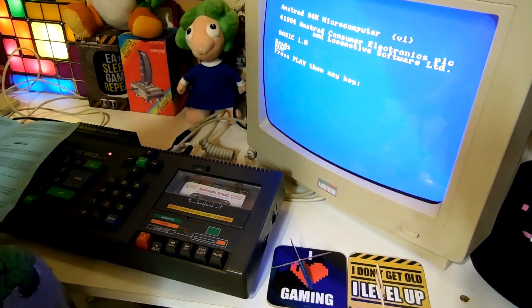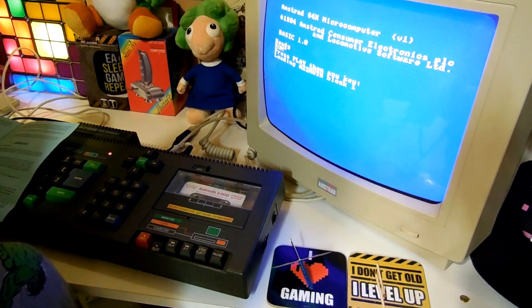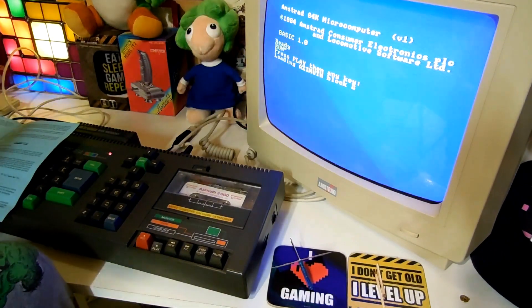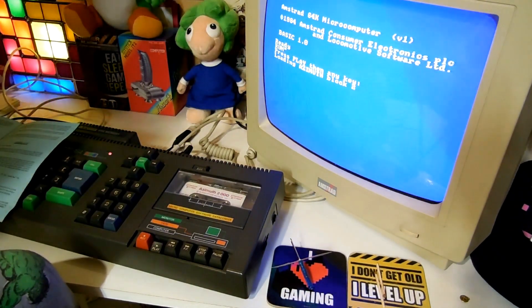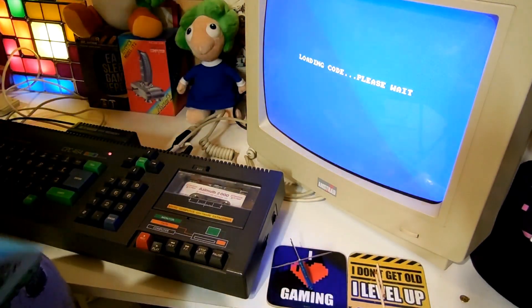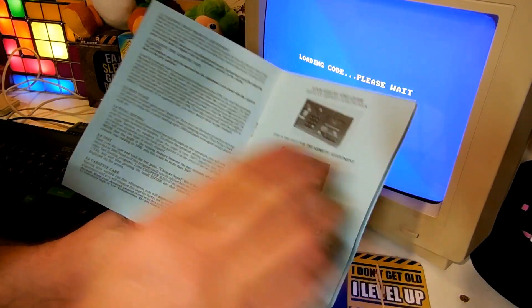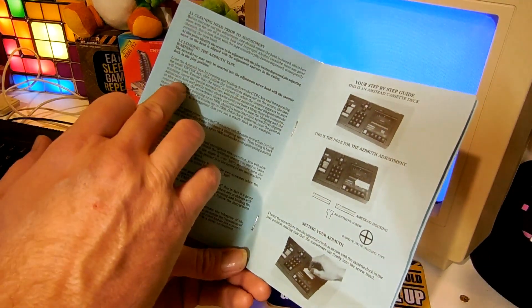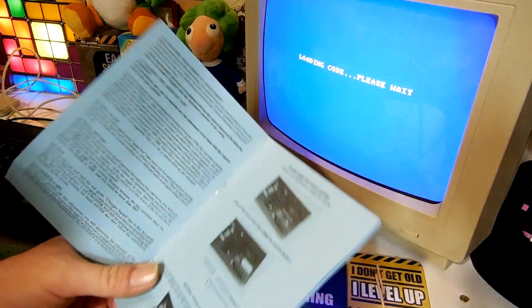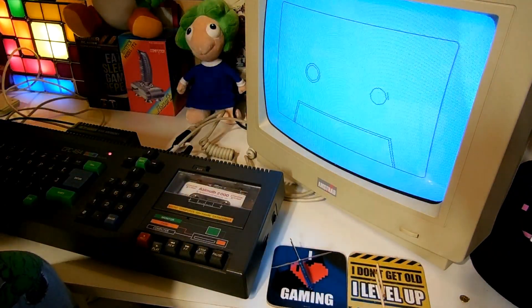See if there's any kind of... we've got something. Well it's certainly loading. So the thing is, sometimes the alignment could be so out that even the Azimuth tape wouldn't load, which would really be a bit of a problem. So you're hoping that that isn't the case, because this CPC is a bit temperamental sometimes. But let's see what happens. Loading code - aha, here we go. It's a case of finding the two extremes of the alignment: one's to the right, one's to the left, and you find the perfect alignment in the middle. That's the idea behind this. Just hoping it loads in the first place, which it looks like it has actually. So we've got the Azimuth screen there.